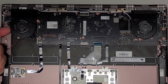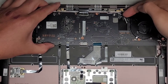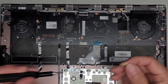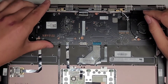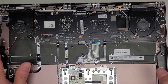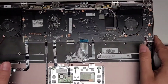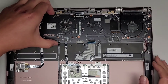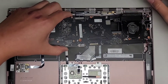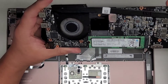As you can see from the fan lifting, it's actually lifting the whole motherboard up. Let's grab the motherboard and slowly and carefully lift it. We missed one screw — there was one screw hidden right there, hidden underneath the wireless card, so don't forget that. We do have to lift it from the left side because the headphone jack is protruding out into the casing. Just slowly, carefully slide it out — and here we go, here's the SSD. They put it at the very bottom underneath everything.